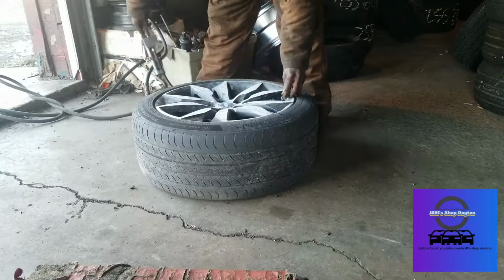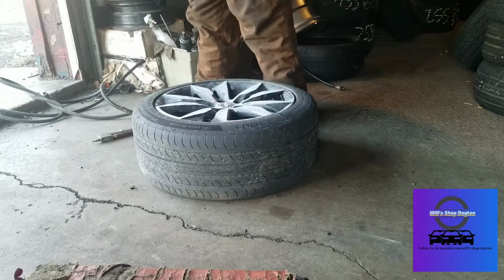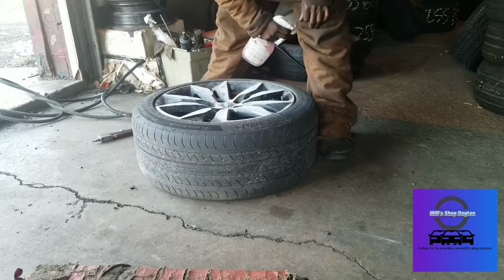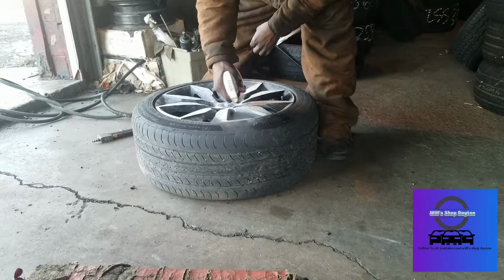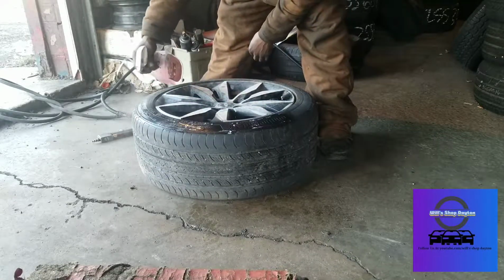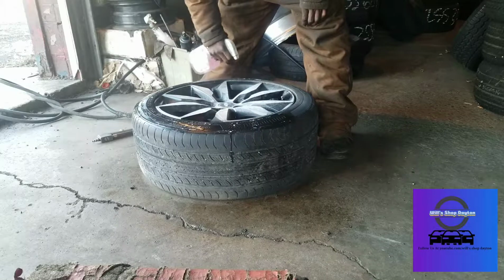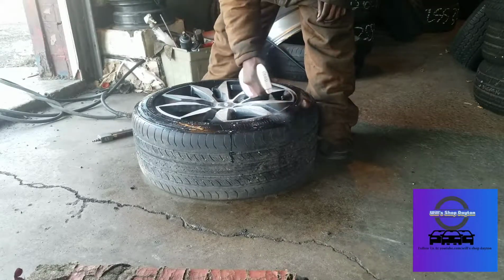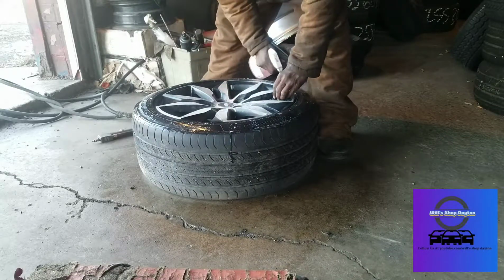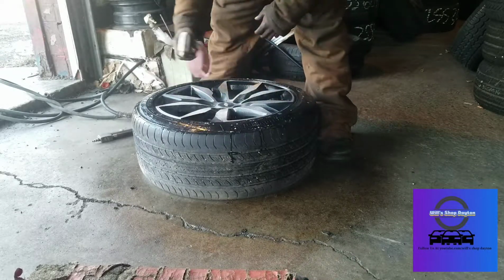Alright, we're going to check that off. Check the entire tire for leaks. See my previous videos, y'all know that we start with the valve stem and the sensor. Just make sure nothing there. We go about checking around the rim and the sidewall. This is just soap and water. It's cold outside, you probably want some hot water. Makes it a little easier to find the leaks. Helps it show a little bit quicker. And we have nothing around the rim. This is a good thing.